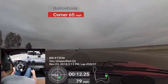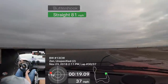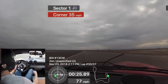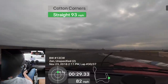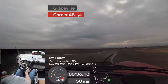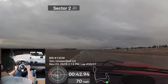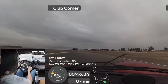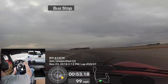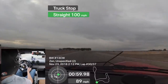That was fun. So even with the big old front sway bar, I get the car to step out still. So it's not like we killed the character of the Elise with the bigger sway bar. We just took advantage of the tires that we put on the front. There we go. There was some understeer. Probably overdoing it on the turn in there. Barely holding on to the pavement there. Woo-hoo-hoo! Holy sh!